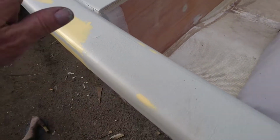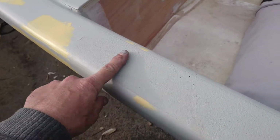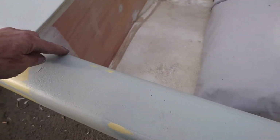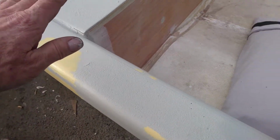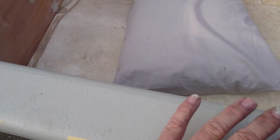So I've got plenty of white paint, and then just do the blue pearl on it. So yeah, with the sanding thing, I put the fiberglass down, had it masked off. I've just done squares, it doesn't matter. Put the fiberglass resin on, rolled it on, and then poured the sand on top, good coating of sand on it, patted it all down, let it harden off.